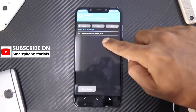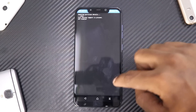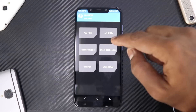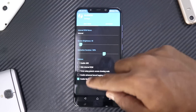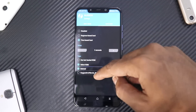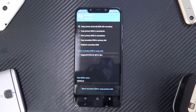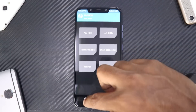You have List ROMs — the second ROM, as you can see, is the OxygenOS beta port for this phone. Apart from that, you have inject boot.img, inject boot sector settings. You have options to make several changes: auto boot, time-based boot, select which ROM to automatically boot to, swap ROMs, duplicate ROMs, and copy ROMs from secondary to primary or primary to secondary. They've got you covered in almost every aspect.